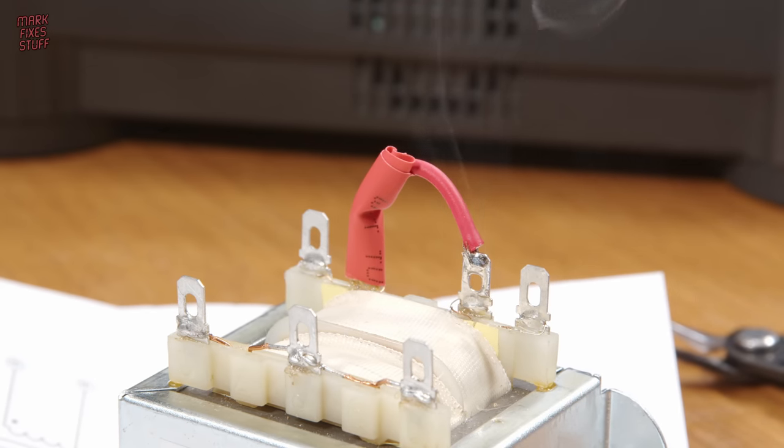Let's unplug the console to avoid any nasty accidents. The new transformer won't fit the console with the tabs sticking out, so we gently bend them down, taking care not to break them. It's a bit fiddly, but feeding the wiring into the right route, the new transformer slips into place eventually. Making sure that the screw drops into the original thread, we secure the lugs on the new transformer.